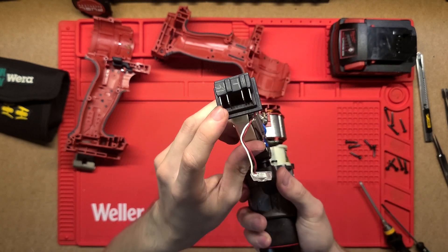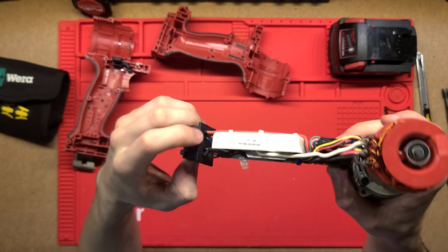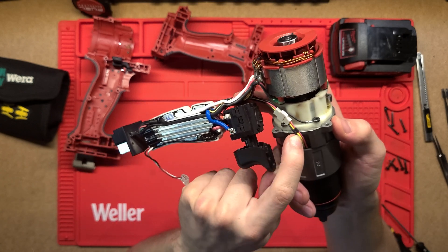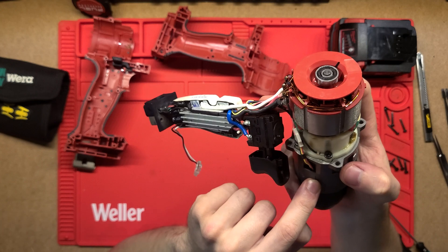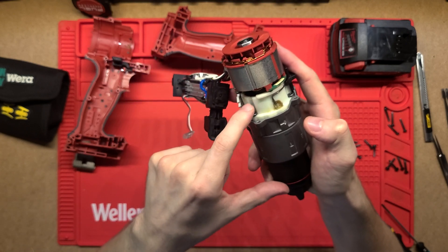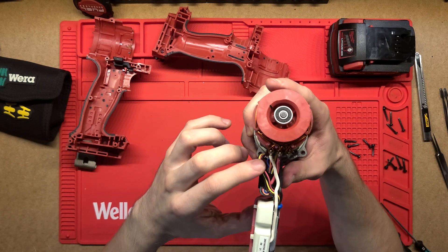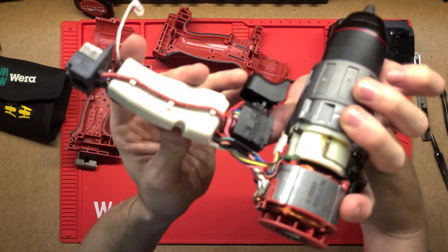On the bottom we've got the battery terminals — positive and negative — plus a couple of extra wires that communicate with the battery electronics, and possibly a thermometer wire. There's also a small connector going into the gearbox with three wires, likely a temperature sensor inside the gearbox. There's a ground wire as well to ground the whole assembly, which prevents static discharge and high-frequency oscillations from causing issues — it completes the circuit back through the board to the battery.